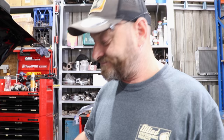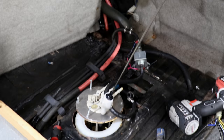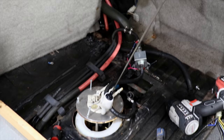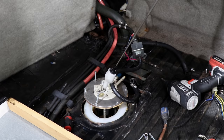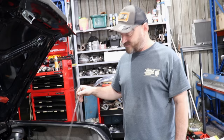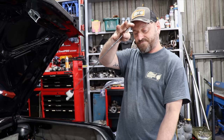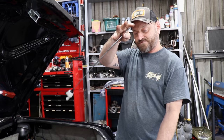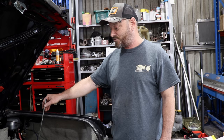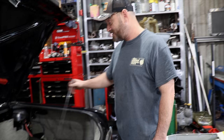That's a fuel pump — that's not meant to be here. It would probably be alright on the back of a BMC Mini or something like that, but it shouldn't be in this boot. This here is the fuel — I'd like to say it's a sender unit, but it doesn't actually do anything except have a pipe that runs up and goes into this fuel pump. So it's not meant to be there, there's no fuel gauge, there's nothing. I'm not really sure what the theory behind this system is. From what I can see, I think it's a Commodore fuel sender unit with the pump in it — one of those spring-loaded things that has its own surge tank built into it. I don't know why it's in there. I guess the fuel sender or pump died at some point and they replaced it with that.